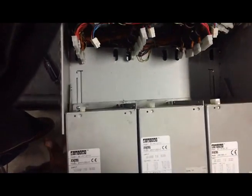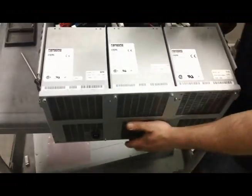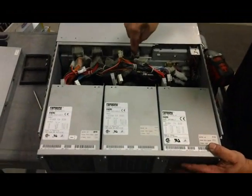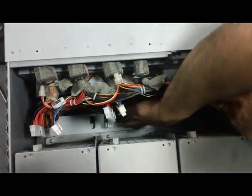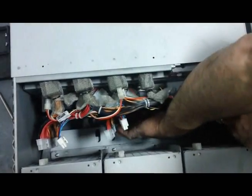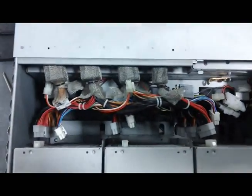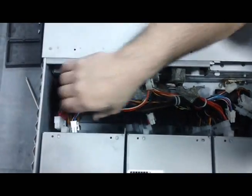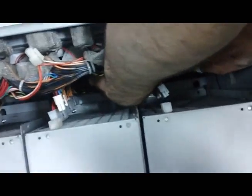Gently feed the tray in and kind of push it in. You see this tab right here — this is where that tab goes into this hole right here. So when you're pushing it back home, make sure you're seating it correctly. Also make sure you're not rolling over any power cables when you push the tray back in, so you've got to be mindful of where those cables are. A lot of times you just tuck the main harness underneath this shelf, then go ahead and push forward, keeping in mind where everything is. Try to hit the bottom connectors first.